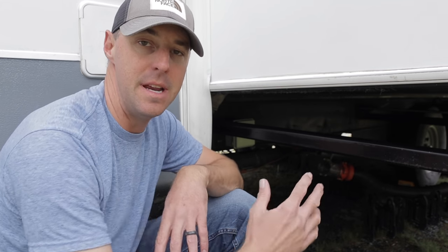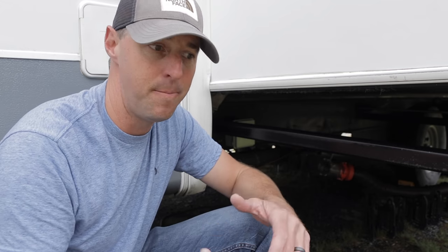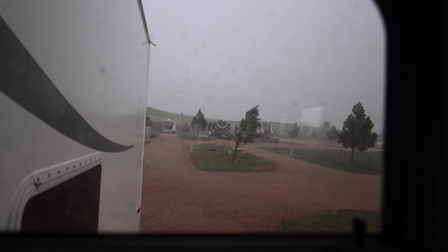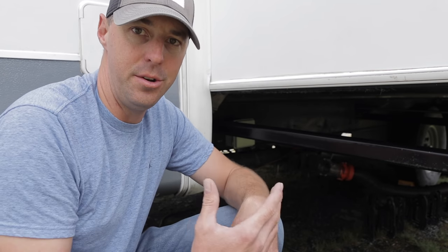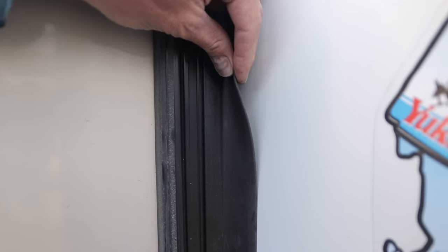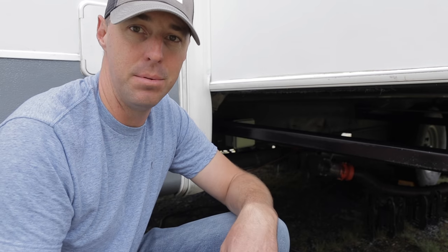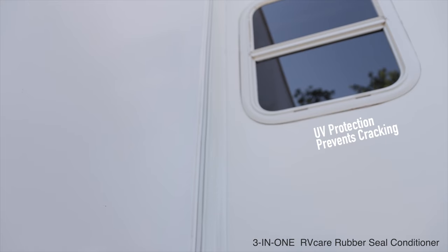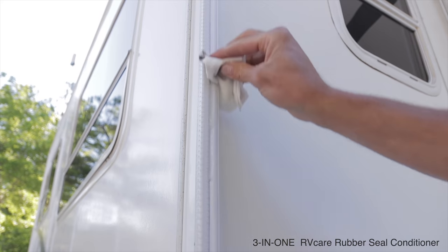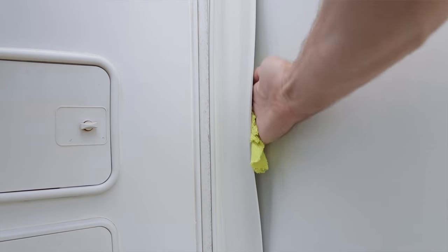The other important thing about your slide is the seal and maintaining it. The seal is important across the board no matter what type of slide you have — it's your first layer of defense against rain, snow, or any precipitation when your RV is set up. It also acts like a squeegee when the slide comes in. Whether you have a thick seal or a thinner one like on the Schwintech, you don't want it drying out and cracking. We can use the three-in-one seal conditioner, spray it directly onto the seal or onto a rag, and wipe it down. This protects it from the sun, gives UV protection, and keeps it from drying out.